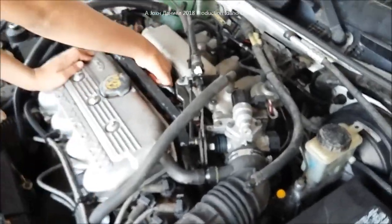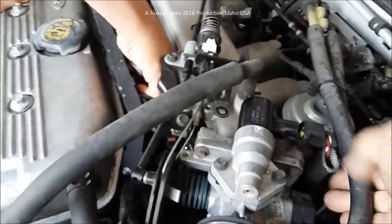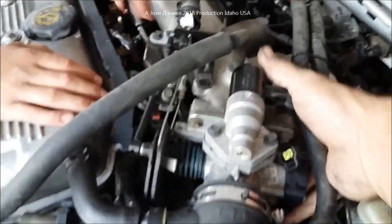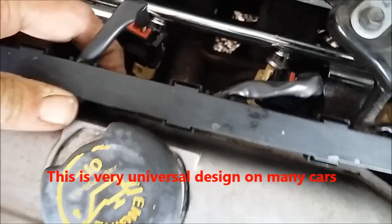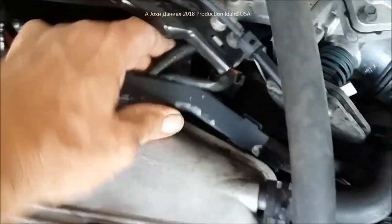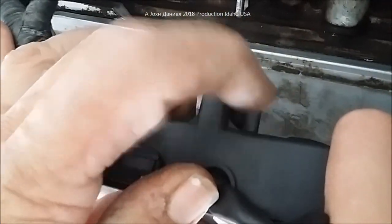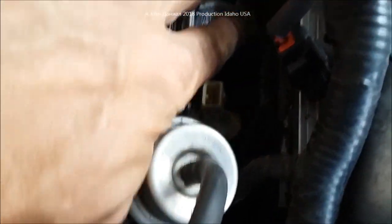Disconnect the battery — that's a must because you're working with fuel. He's going to start getting the fuel rail removed. Right over here connected to that same injector line set is the idle air connector, and down here the throttle position sensor — get those loose. There are tabs right down in here, one on each side; push them in to get the electrical rail off. Now that we have it off, we have access to the 10 millimeter bolts down in the bottom.